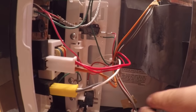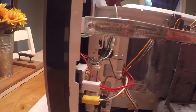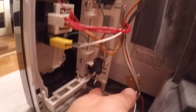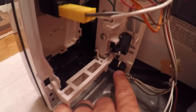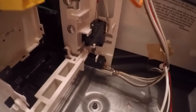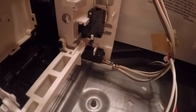The part we're working on today are these switches. You'll see one switch is here, another switch is here at the bottom, and one more switch right here in the middle. The most likely issue is one of our door switches. If I open the door you'll see there are hooks, one on the bottom and one on the top. Those engage switches that either connect or disconnect a circuit making the microwave work. There's one switch controlled by the door here and one switch controlled by the door here. Most likely my issue is related to this lower switch. I've had this same problem before - the lower switch controls everything except for the light. The top switch only controls the light, and the light is working. So the heat and the turntable all stem from the switch on the bottom of the unit. Now I just have to remove that switch, find out what kind it is, and purchase a replacement.